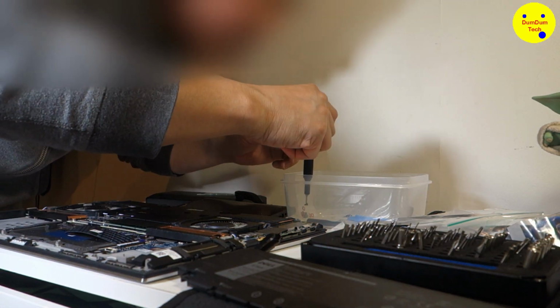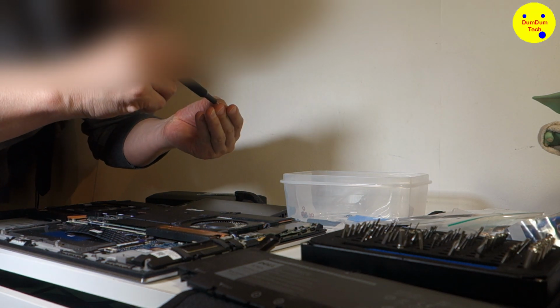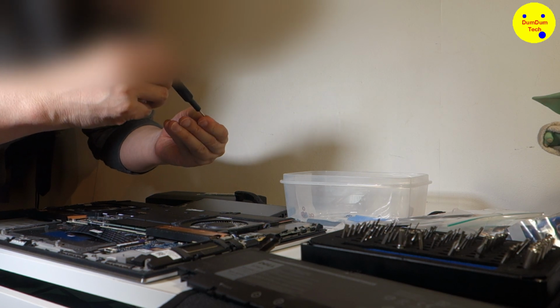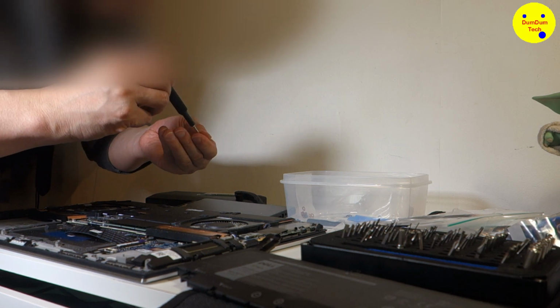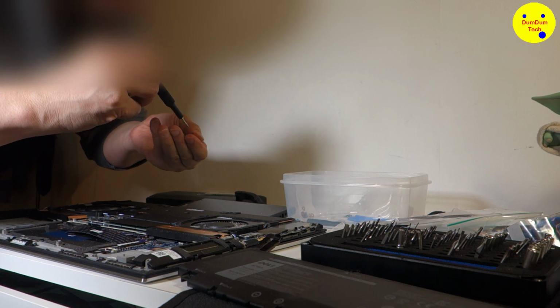and that's it. I managed to get the battery back in, put the 2 terabyte drive in the SSD 1 slot, and put the Micron that came with the Dell, the 1 terabyte, into SSD 2. The next stage, I'm going to show you how to boot into the 2 terabyte drive with the Windows clone.